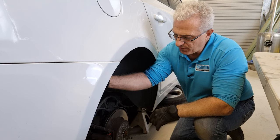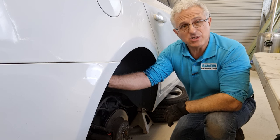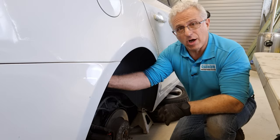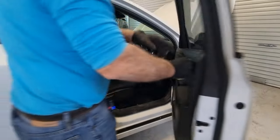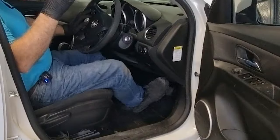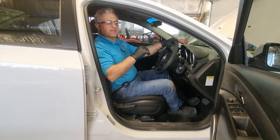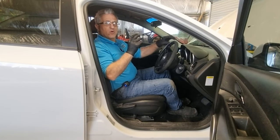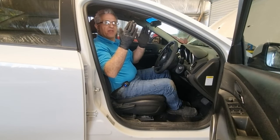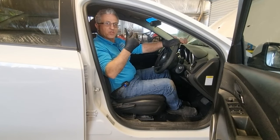We're done. Before I go any further, I'm going to test the brakes — just pump the brakes to see if it's too soft. If it's soft, it means there's air in the line and we'll have to bleed the brakes. We need to do that now before we put the tires back on. That's perfect. When you first pump them they will be soft because we've pushed all the pistons back. What happens when you pump it is it's going to push the piston and push all the brake pads back onto the disc, so it's going to take a few pumps to get the oil pushed back into that position.